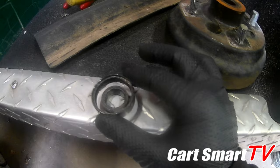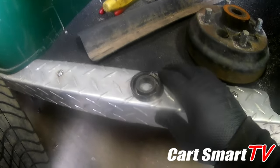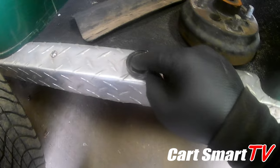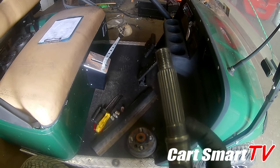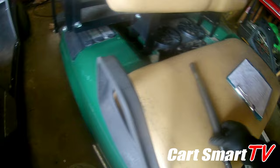The bearing is completely blown apart. The folks not knowing this was going on, the rear axle seal also got torn up — it had started to sag really bad because of the weight of the axle on it. We got in here, got our axle pulled out, and got the inner bearing race pressed off. We've got a new axle seal shoved up in here.